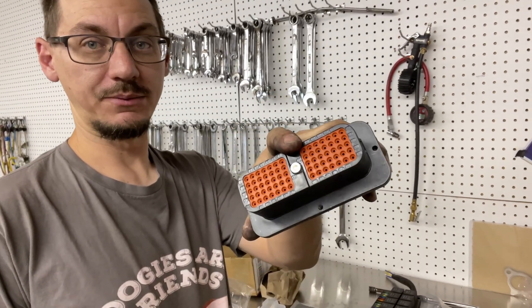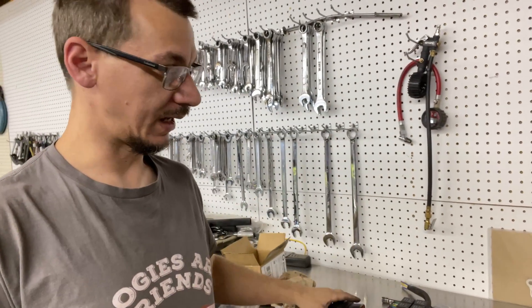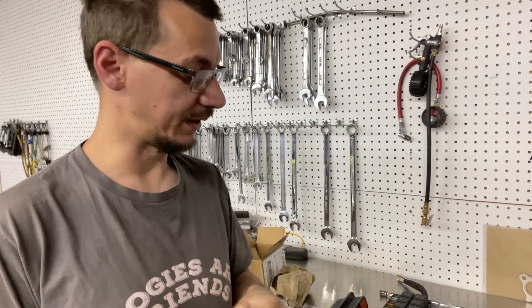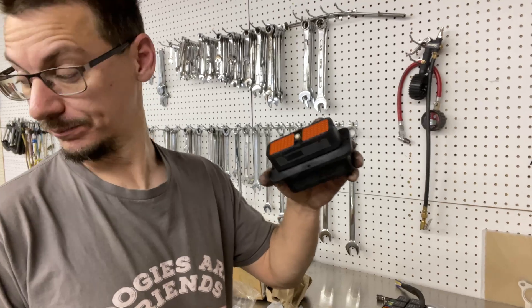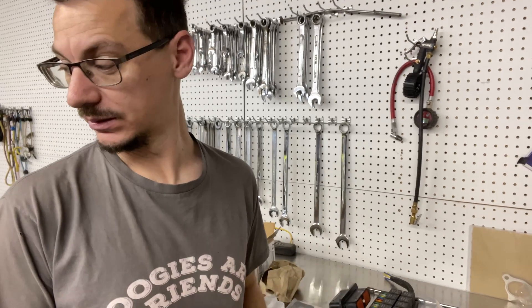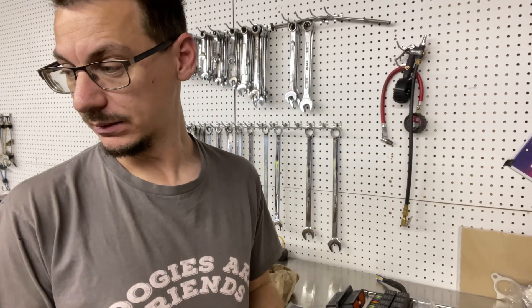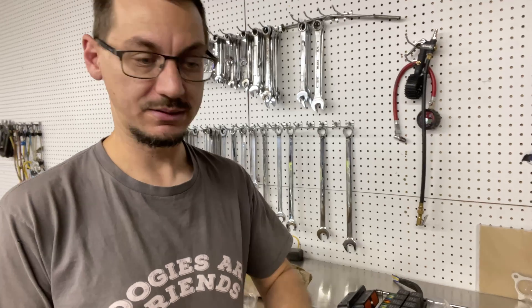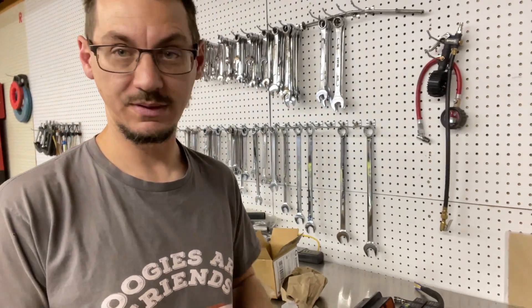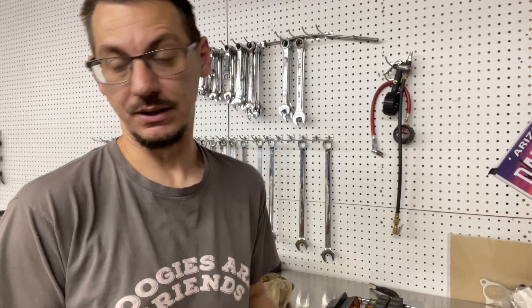I got my wire harness connector for the engine — it's got a little bolt on it and all the little wires will go through it. I also have two connectors coming for the starter wire and the alternator wire that are different, since this connector isn't meant for something like two-gauge or possibly zero-gauge wire. I got a quick disconnect that works for four to zero gauge, and I think six to four gauge for the alternator since that one's probably a six. That way I can disconnect just three connectors and the engine is completely disconnected from the car, other than the chassis grounds.